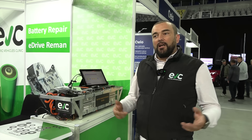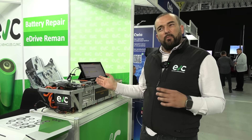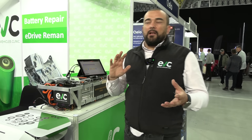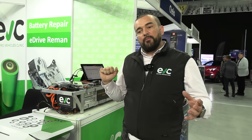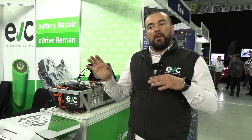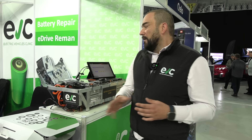Nissan Leaf has the same issues. Volkswagen E-Up and some other old vehicles — can we extend the life of those? So we started the project almost nine months ago. I designed the system: let's use an external battery which will be connected in parallel with the existing one. But we will need to design a complete self-sustainable BMS system to communicate with the original battery pack from the vehicle to see the voltage drops, voltage deltas, temperatures and all other safety-related data.